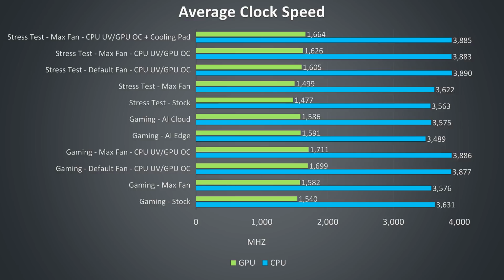However, as we can see, with the undervolt applied, we're able to get the full 3.9 GHz all-core turbo speed of the i7-8750H, even in this worst case scenario. Impressive stuff. It was also possible to boost the power limit up to 62 watts manually with Intel XTU. However, that would have also raised the temperatures, so I didn't take that route and instead stuck with undervolting.